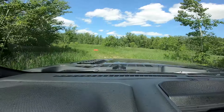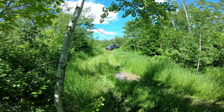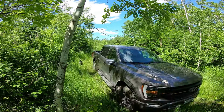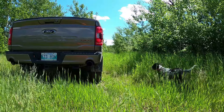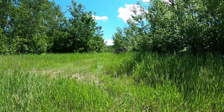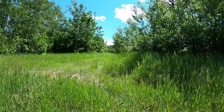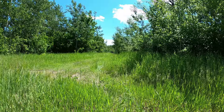The real test will come more in fall and early winter when we're using them for hunting and wood cutting, when there's snow on the ground — we'll see how their ice traction is and everything. But so far, my initial impressions after two hours on this vehicle: you can tell they're heavier because these are LTs, load range E tires, whereas the General Grabber ATXs they put on these Tremors are not the LT version. So it's a heavier tire and you can feel the difference — you can feel it when you're braking and in the steering wheel. Not saying it's a bad thing, just you can tell. I've always had Duratrac LT tires on every truck before this, so this is what I'm used to, not the RT of course, the old regular version. But I'm used to the weight of those tires.